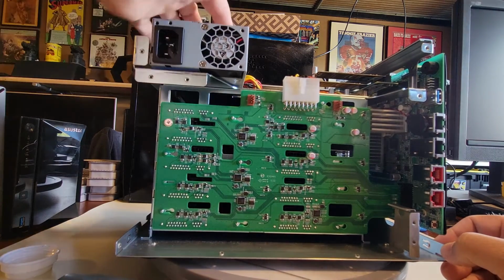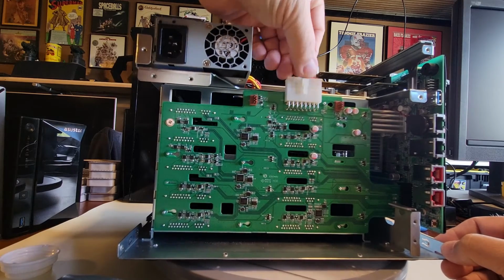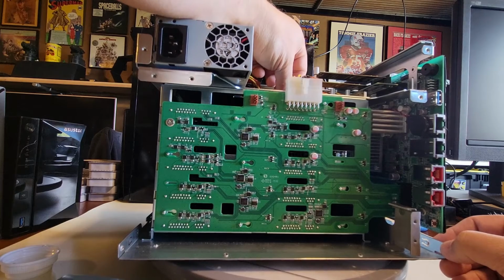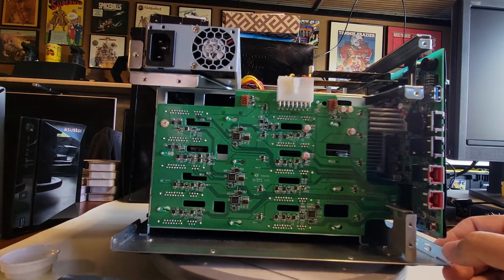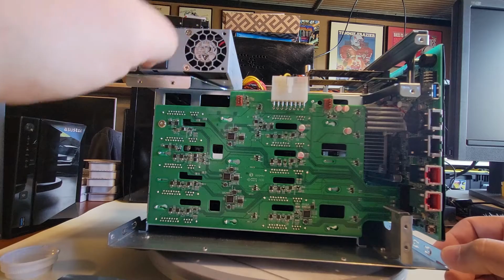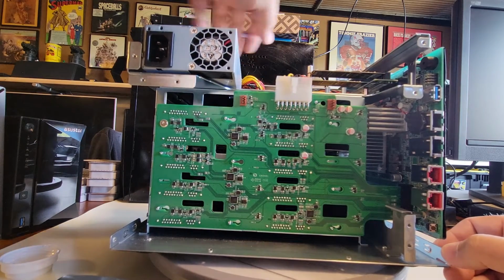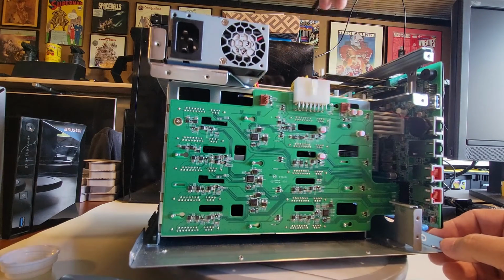I mean, look, there's two screws on the back side of this power supply. That would come off pretty easy. I disconnect it here, disconnect it from the system board, right? Unzip tie it here with a couple clips, right? And this power supply is out. In fact, I don't have to take this whole back plane off, or this bezel off, to get to this power supply. I could have just taken out these 4 screws, 2 in the back, made a few snips, and still got to it. Same with the NVMe. It's very accessible from here.